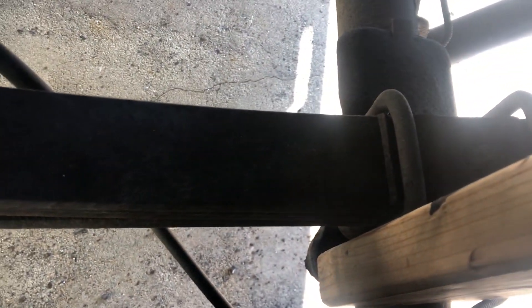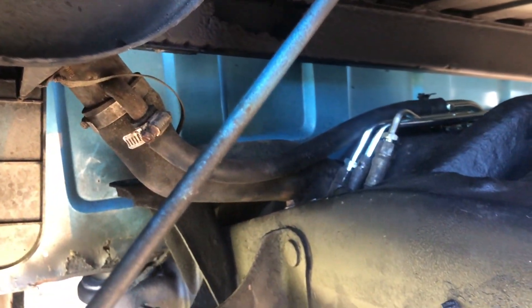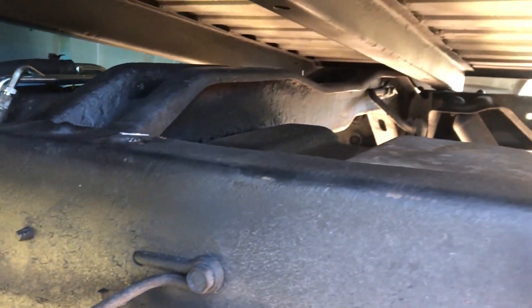I had to change the fuel sending unit. I just want to show you guys a different way of getting to it, since everybody might not have an engine hoist and all that stuff. What I did was take all the bolts out of one side, loosen them on the other side, and lift one side up like this. I'm going to put a little 2x4 or 2x6 up there going to the axle to hold it up. It gave me plenty of space — I had to maneuver around some stuff, but plenty of space to change it out. If you want an alternative way of doing this, that's one right there.